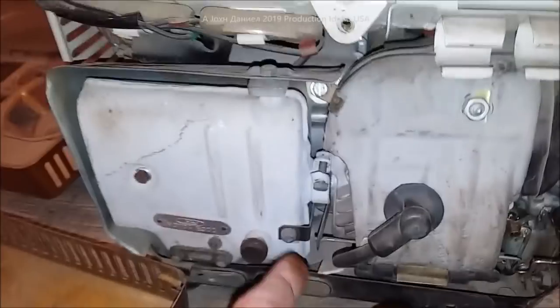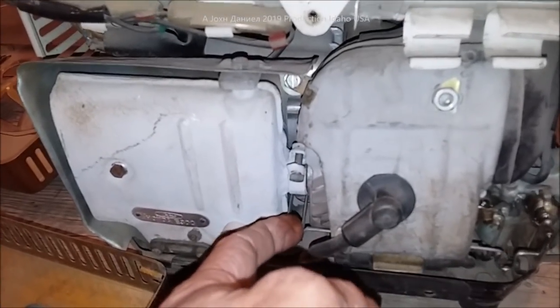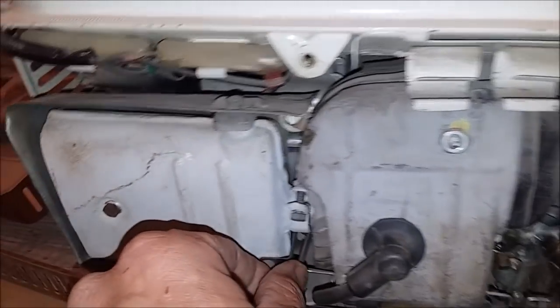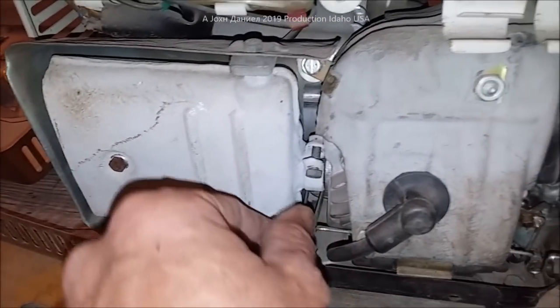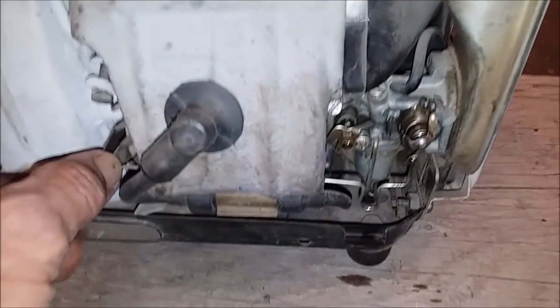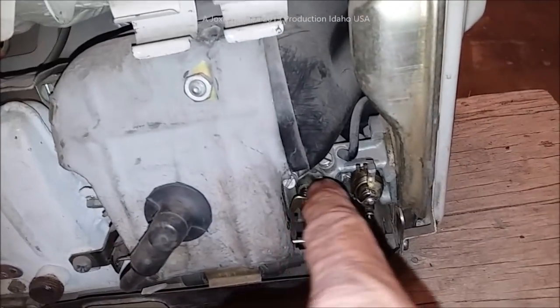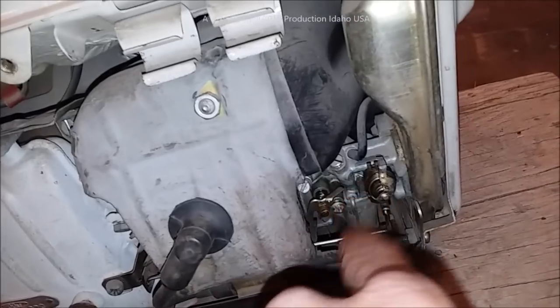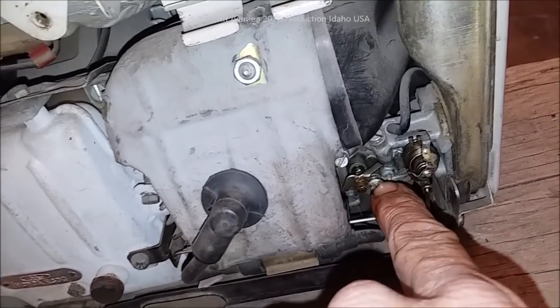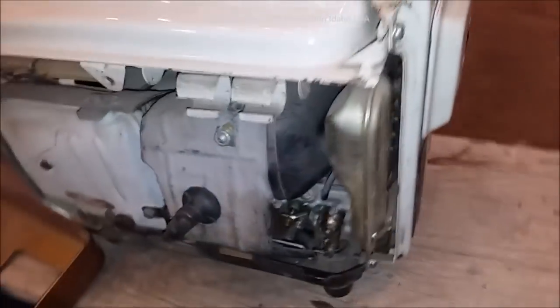There we go — so it goes up in here, and this is what keeps it running. The blower of the cooling fan will actually push on that and move the throttle — see that right there. And this right here is the mixture where you can set up the mixture on it; there's a set screw for where it stops. So we went ahead and took it all apart and checked it, and everything was working good.